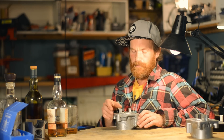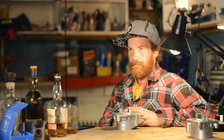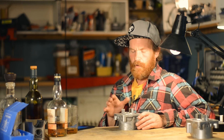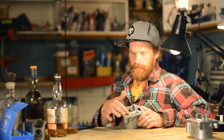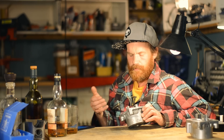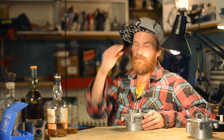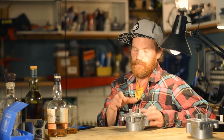And it is tested — there's a Kiwi company that has been running tests, and I've talked to one of the guys who was designing and testing, and it did work. The other thing that makes this hopefully better than other cylinders is these huge rear transfer inlets. They are shaped to not bend the flow in the B-transfers in more than one plane — the flow has to bend from the crankcase into the cylinder, but there's no bending around anything, like it's happening in most other cylinders. There are a couple of tiny RC cylinders I've seen designed like this.